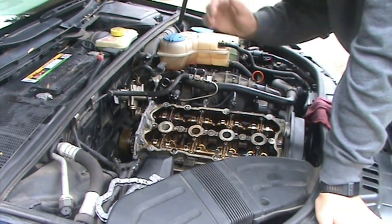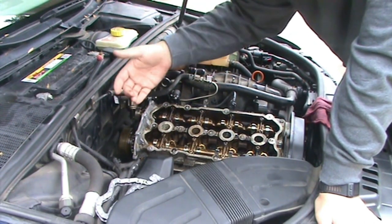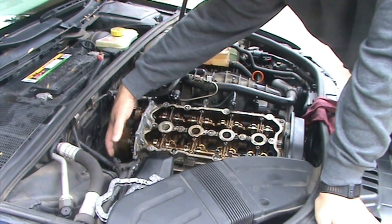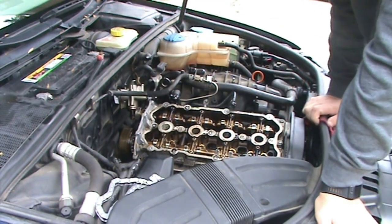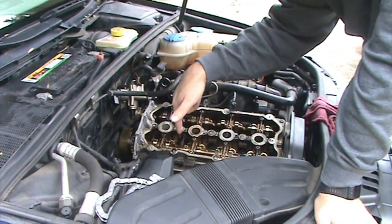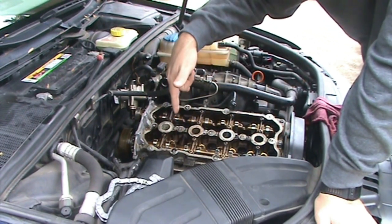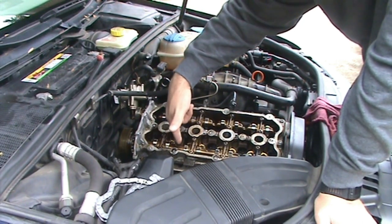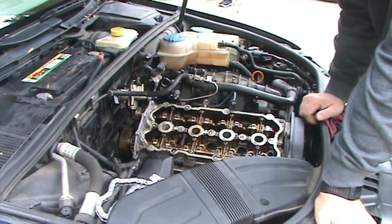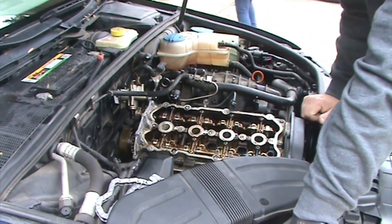The correct way, they were all saying, is you need a poly drive socket that goes in the screw in the back of the VVT. Then you take that off the cam to allow you to put the new chain on and install it back, making sure you have your timing set correctly. The only thing is, none of them seem to mention the locking plate you need to hold the cams in place while you're doing this. That plate has two big metal cylinders that go down in these grooves in the cams and lock the cams into position, sort of. Even with that in there, your timing could be off by at least a tooth, according to some reviews.